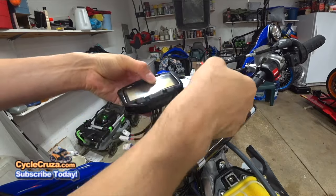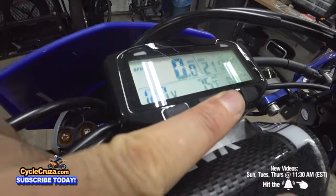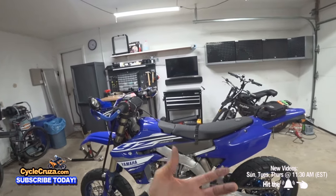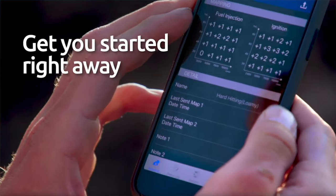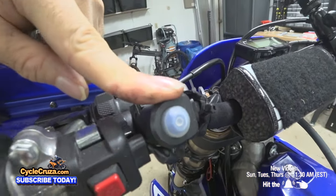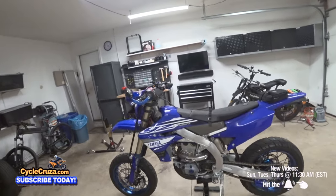For the supermoto build you're also going to want a speedometer. I made a custom bracket and installed the Trail Tech Super speedometer, which works great — it gives you engine temperature, a voltmeter, speed, and tracks hours. But you don't even have to track hours with that because the Yamaha Power Tuner app on your phone tracks the exact hours the bike has and gives you reminders when maintenance is due. You can also tune the power of the bike through the app. The bike has two map switches — the first is full power, the second dials it down so you don't need full 450cc power in the woods.